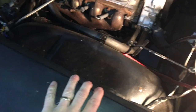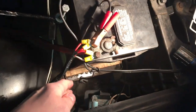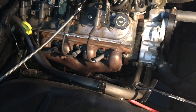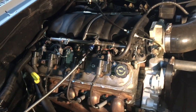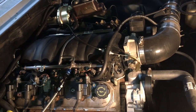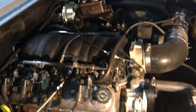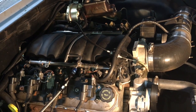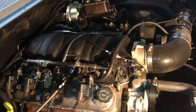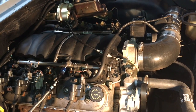The computer is tucked right here under the fender next to the battery. I just used the computer bracket from a truck or Camaro that I got from a junkyard, and bolted it to the inner fender so it's tucked away. The wiring harness is a stock wiring harness that I just cleaned up. The throttle cable is a universal throttle cable from Lokar. The gas pedal is from a 1988-to-'98 Chevy full-size truck, but I did have to cut it up and weld it quite a bit to make it fit — it was definitely not a bolt-in thing.